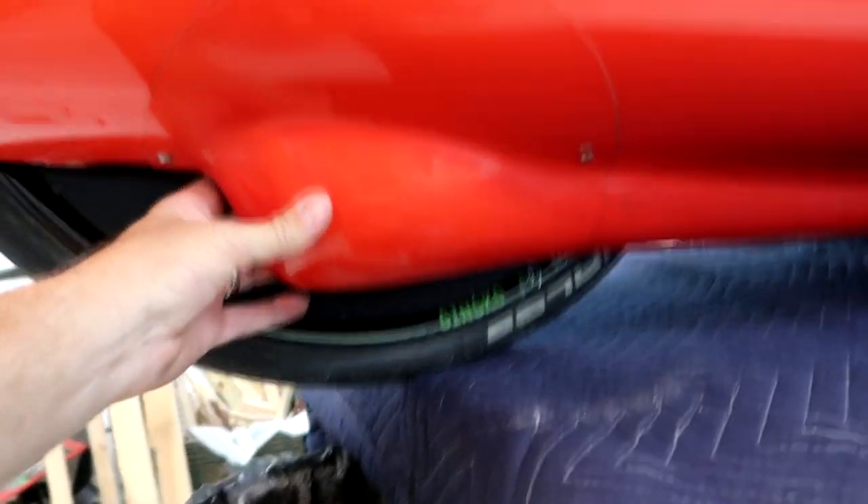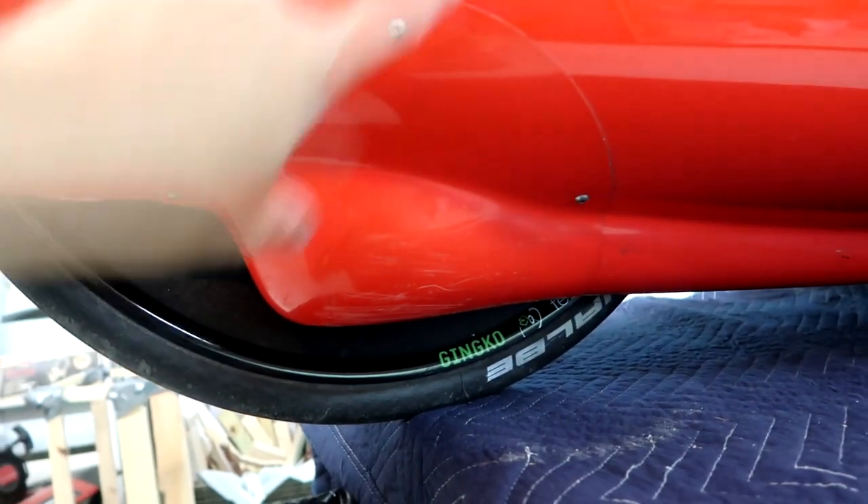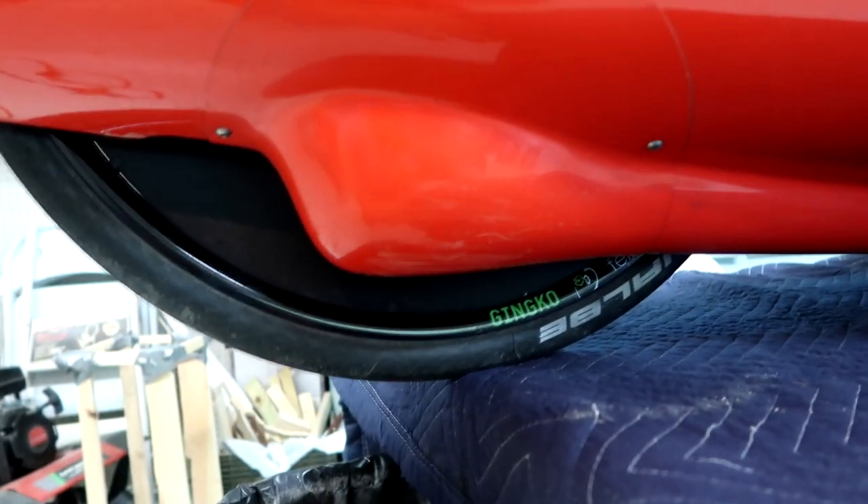Before I get started, how am I going to do this? You could go to the Archer Components website and see how they install it on mountain bikes — basically it just bolts onto the rear triangle of the frame. You can't do that in a Velomobile. Inside the Velomobile, this is where the rear wheel is. There's a cover here and another cover here — these are the two chain covers. Those of you who have a Quest know this cover comes off right here, and then I'll be able to get access to the rear derailleur. I have to disconnect the shock and lower the wheel down.